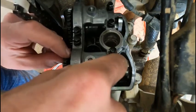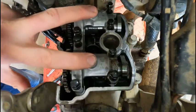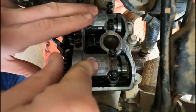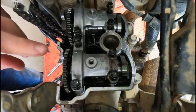All right, we're gonna slide this back on top of here and kind of slide the cams back and forth till the rings on the bearings fall into their home. You wanna make sure you can get this cap pushed all the way down by hand. You don't wanna have to try to suck it down with a screw, because that means something isn't lined up right and all you're gonna do is damage it.